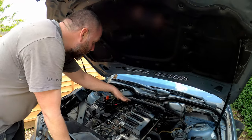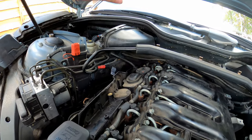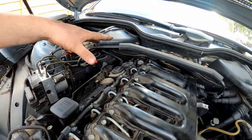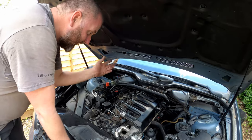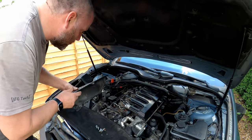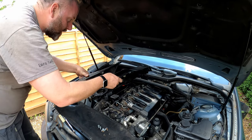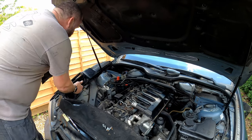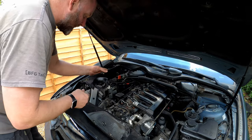As you can see, we've got really good access to the breather valve now. I've removed quite a bit of stuff in order to be able to get good access to it. It looks like a lot, but it actually took me about ten minutes to get it to this position. You've got the inlet which sits on the side of the air box like so. Once you've got that off, literally it's just three screws, and you'll obviously be left with this.